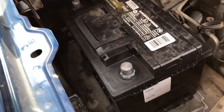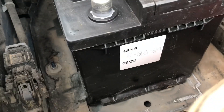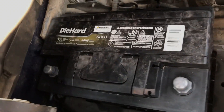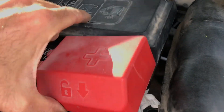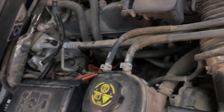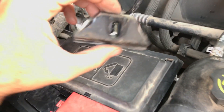When you get your battery in there, make sure you take off your terminal covers. Always write on it the year that you put it in so you'll know and won't have to dig it out next time. You can also take a picture of the top to get all your information off, because on this Chevy you're going to cover it up with this thing. Now pretty much do the opposite of what you did when you took it out — put the container back on, screw those back in, put the side part that clips the battery in, and then hook back up the terminals.